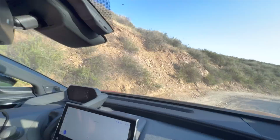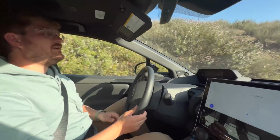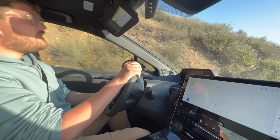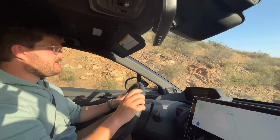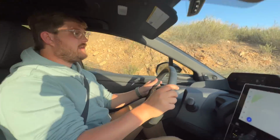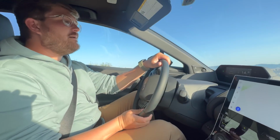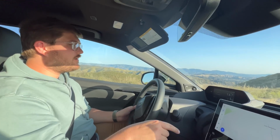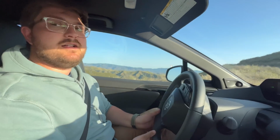Let's just go this way, high side and around. The parking sensors are going, of course. Traction control just flashes when we lift a wheel. You always want to get as much regen as possible, and it seems like X mode prioritizes friction brakes over regen with the car's system. And that could just be because they don't have enough fine control of the motor to do regen through ABS, but I think it's kind of a missed opportunity. But I think Subaru actually did all the development work for this X mode system. And again, I am fairly impressed with it, at least in undulating surfaces.